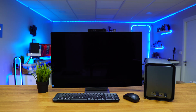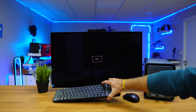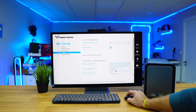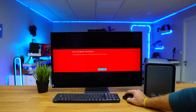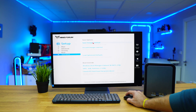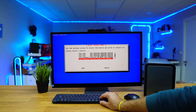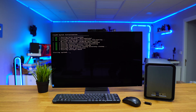Insert the USB into the NAS and press Delete once we press the power button so we can choose the boot disk — at this moment it will be the USB we want to boot from to install ZimaOS. We will also need to disable Secure Boot, which will be required on most recent motherboards. Search on the Security tab and don't forget this step because it's important to be able to install the operating system. Then save and restart and it will boot into the ZimaOS installation menu. It's as simple as following the menus, and once finished it will restart.